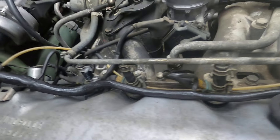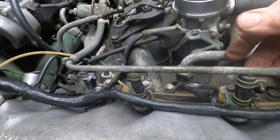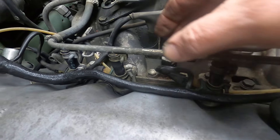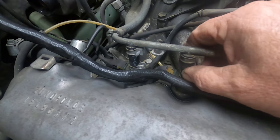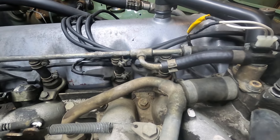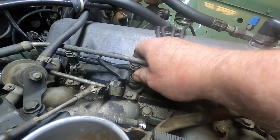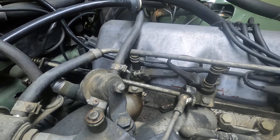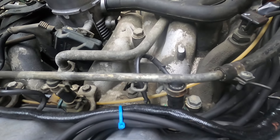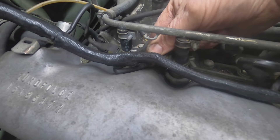While you've got the air cleaner apparatus off, it's nice to look at these fuel rails with these little short connecting hoses into your fuel injectors. I understand these can get cracked and hard over time and can be a fire hazard, so checking them visually and touching them to make sure they're still pliable and not cracked is a good idea. All of these look very good — there are eight of them, four on each side in this V8.